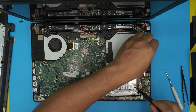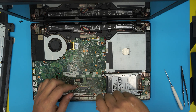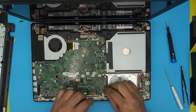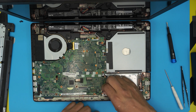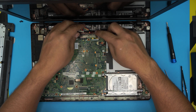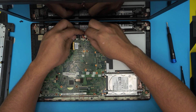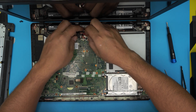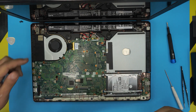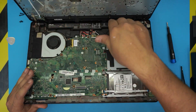I made another video on how to upgrade the hard drive for this model — you can install an SSD drive, which is much faster than a mechanical drive. Run the flex cable and plug it all the way down into the jack, then close the lid. For the battery cable, align the contact and push it toward the motherboard. Make sure nothing is in the way, then put the palm rest down — set it at the back first.